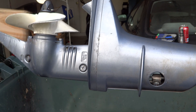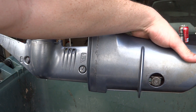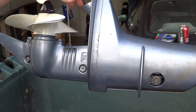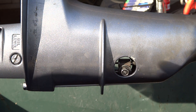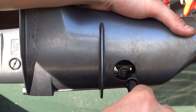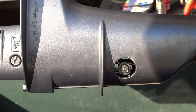If it gets a little snug, take your two-by-four and just tap it in — that's good right there. Now put your four 10-millimeter bolts in the bottom. Don't forget your little zinc tablet. The case should be 100% flush. Make sure the bolt is pushed in just a little — when you're pulling it you don't want it to hit the casing or nick the bolt. Then give it a good tighten.